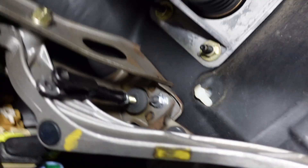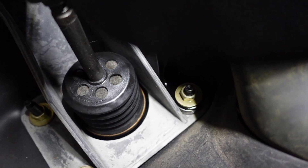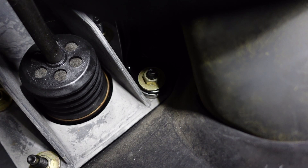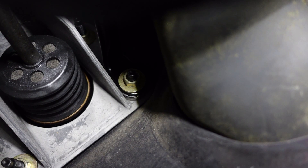I'm going to try and get my big head under here and also try to record this. So there are the two left bolts to the brake booster — there's the bottom bolt and then there is the top bolt up. This bottom bolt to the right has a black bar that goes to it. Behind that black bar on the face there, there's another nut behind that nut. Toyota's infinite wisdom was that when they do this, you have to drop the entire steering column and everything to pull this black bar out. So on my wife's car I put a washer behind it so I don't ever have to do this again. This sucks. You have to literally drop all the plastics and the steering column. When I do this I'm just going to put a washer — so if I ever do this again, the only thing I have to do is remove the nuts, which are obviously easy to get to. You also have to pull the pin for the actual brake. Besides that, you're done — it's very, very simple. It's just that one nut that sucks.